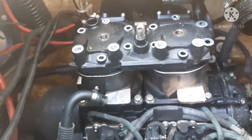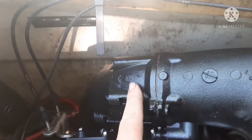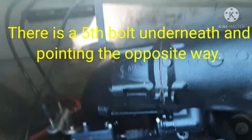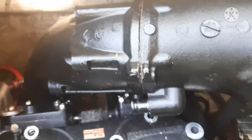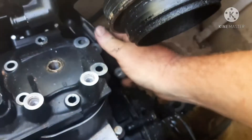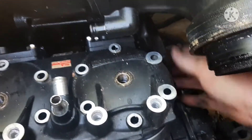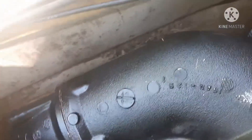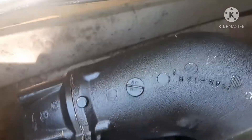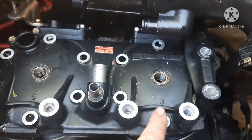We're about to get the first look at this head. I can't figure out what is holding this — I've got the four bolts out. I don't know if it's an alignment pin that's seized up just because it's so old. But you can see I've got some movement, you can see the space. It flexes a little bit pushing down on this, but I can't figure out what's holding it. I've got a bracket right here that fits on to it with a bolt, but it's not connected. Those first two head bolts are connected to the exhaust and they're longer than the rest of them — they're all 12 millimeter.